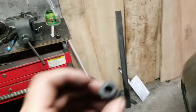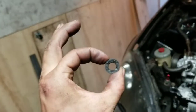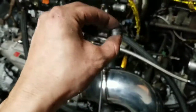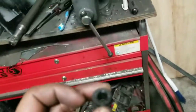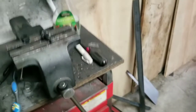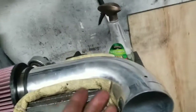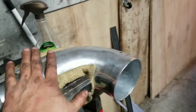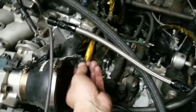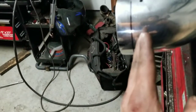Find a drill bit that's slightly smaller than the outer diameter of the hose. You'll drill the hole, put the hose piece in, use a little lubrication, then press the sensor into the pipe. For step one, mock up your intake in the car and see exactly where you want the sensor. I marked it exactly where I wanted it — also ignore the other line, that's just marking how far I'm going to put heat reflective tape.